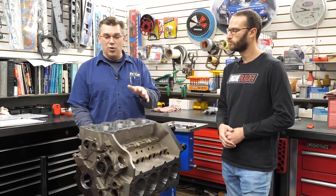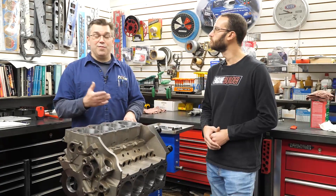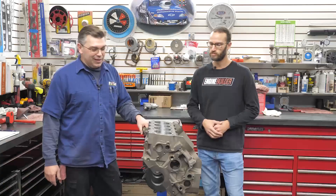The deck surface is not always the exact size — they give you usually a couple thou. This is a 9500 small block Ford. You might have a couple thou over that to get back to what you'd call either zero or how far you want the piston in the hole. Those kinds of things you work out mathematically when you buy all your parts. In our case, we went with as long a rod as we could get — we like the taller decks. That's the trend with all the big race stuff. We have a 6200 rod, a little bit longer than a 6125. This block is set up so you can go up to a 4250 stroke, and it comes already clearanced. So you don't have to do a ton of clearancing, which is the beauty of this block.